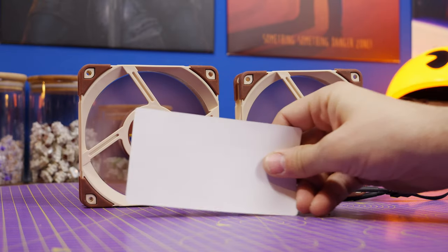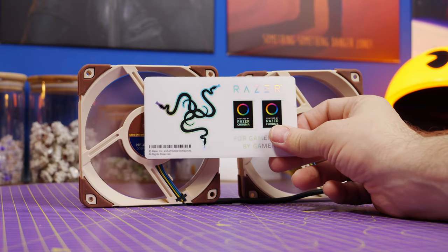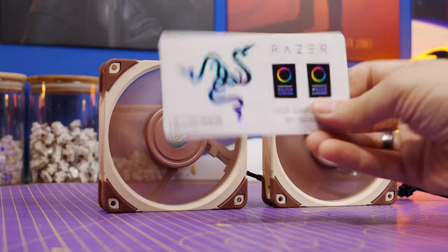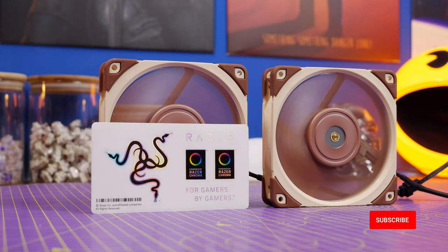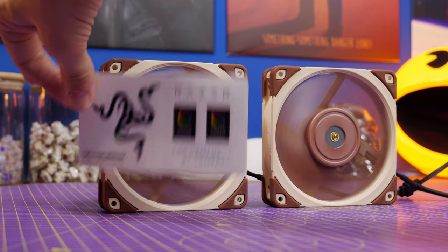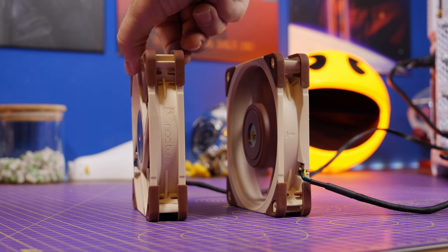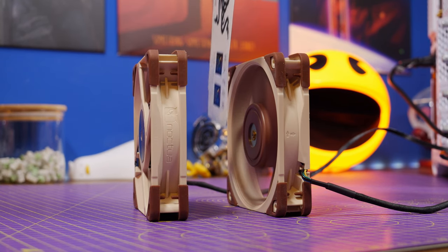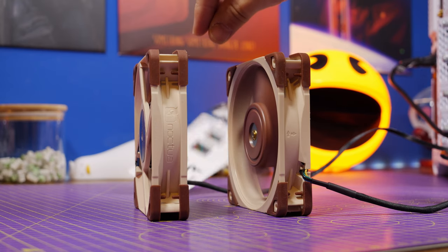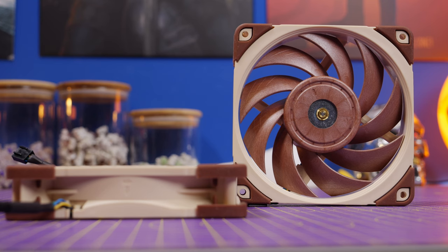You can see me trying to demo this here with a bit of card, where essentially the rear of this fan should be blowing and then the front is sucking, because the card will get stuck to it. I'll demo this more successfully later on. You also need to think about not putting fans in close proximity where they'll be fighting each other — you can see I've got a fan facing one way and another fan facing a completely different way, and they're obviously going to impact each other.